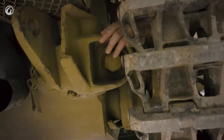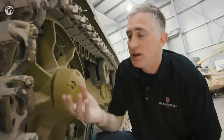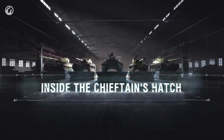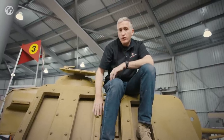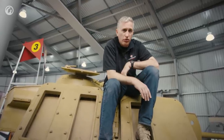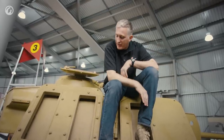Track tension is conducted by use of a large bolt — a fairly unoriginal system. You simply turn the bolt, which is attached to a worm drive that moves the idler backwards or forwards. The turret has been traversed to the three o'clock position, which is necessary to allow opening of the engine decks, and this shows the size of the holes put in for the tropical modification for tanks that saw service in North Africa, along with the mushroom housings to cover the gap.